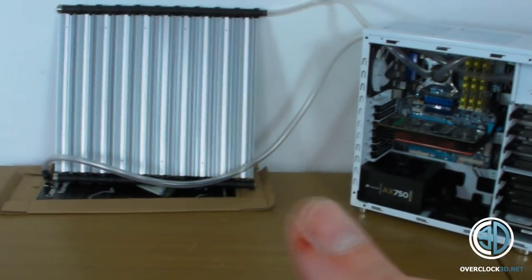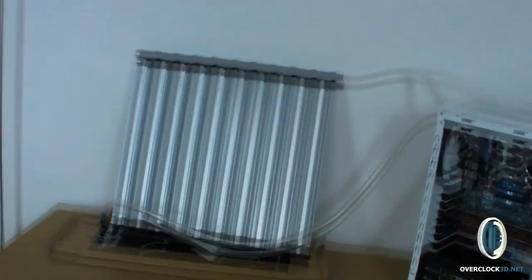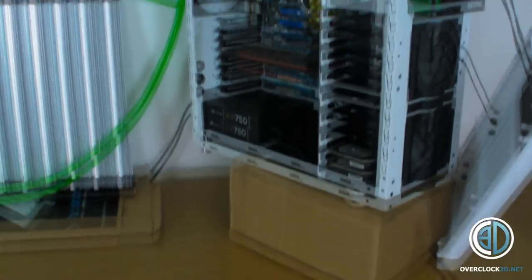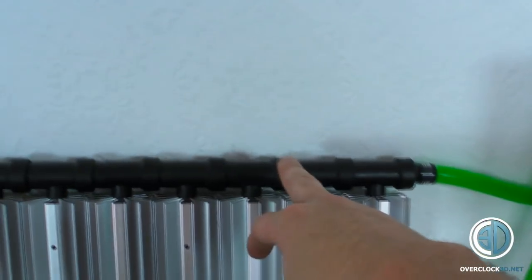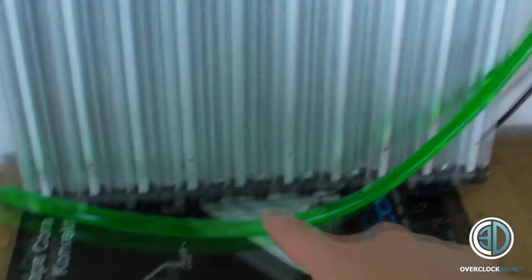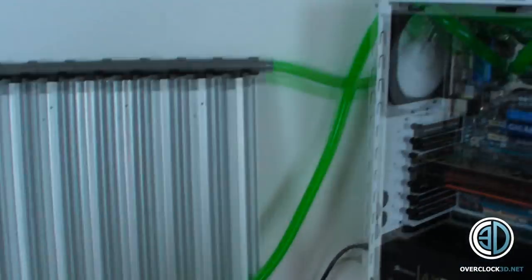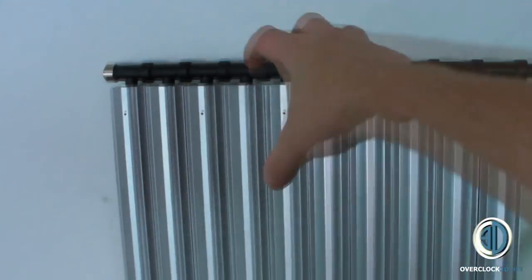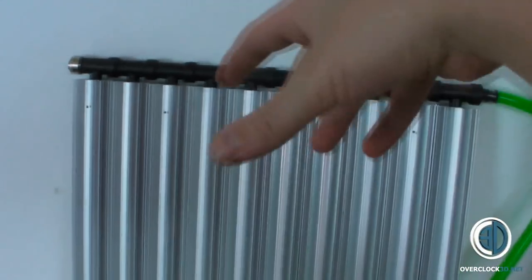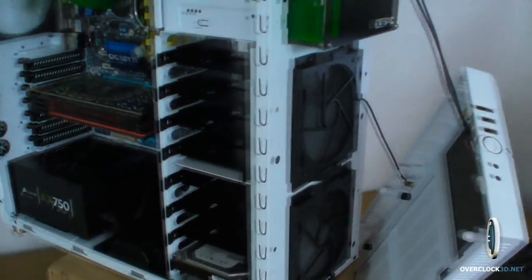I've actually had to take my t-shirt off. Casualty - TTL blood, not good. Leak checking - the case has been put up basically so I can get the top of the reservoir higher than the radiator, which obviously helps for getting the flow down but also getting the air up to the highest point. That's also why I've used long loops, and it helps me move the radiator around because I've been tipping it upside down to get the air out. Air will normally sit at the tops, so I've been flipping it around to force it out and I'm pretty sure we've got everything sorted now.